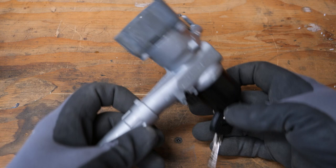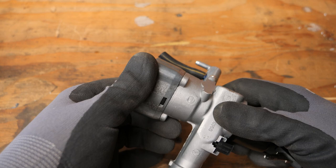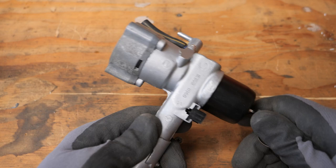Okay, so here on the workbench, this is pretty much ready to go. I found another 4mm metric fastener to complete this trio of screws that holds this switch on. I think between the pot metal shaft that interlocks with this switch and the fact that one of those fasteners was missing, I wonder if it got off axis just a little and that's what contributed to the failure. But this little switch is on.